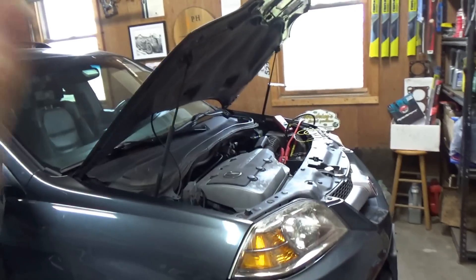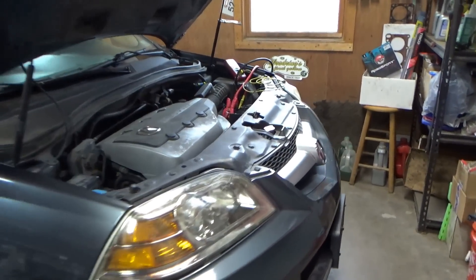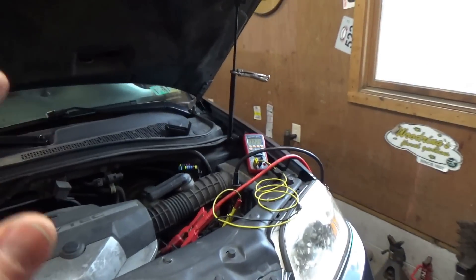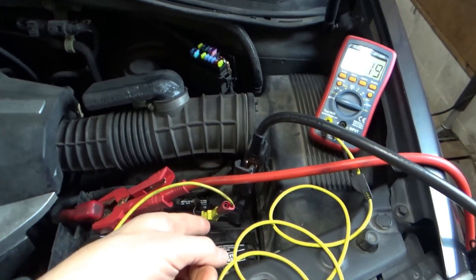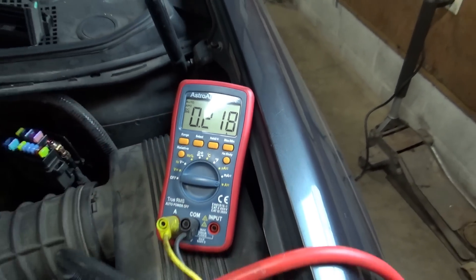To make this video quick, I've actually already completed the diagnosis, but I'll walk you through the steps. First thing — pulled the car in and threw my ammeter in series on the negative battery post. Right now you see 220 milliamps. That's not normal; that will definitely draw your battery down — not in 8 to 10 hours though, probably 2 or 3 days at that rate, like a little dome light being left on, unless your battery is already depleted. But initially the car went to sleep in less than a minute: 16 milliamps.